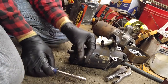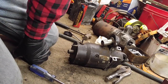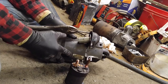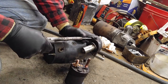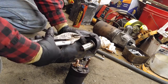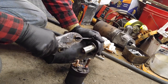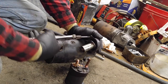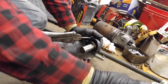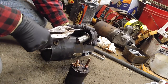Yeah, that needs a tap run through there. I'm going to pause you. You don't need to watch this. I got a tap, and I clamped it into a vice grip because you can't swing the handle. And you turn it, and you go back. In case any stuff is clogging the little area between the cutters, just spray a little bit of cleaner in here. Just anything. Rinse away the stuff that may get caught in the threads.